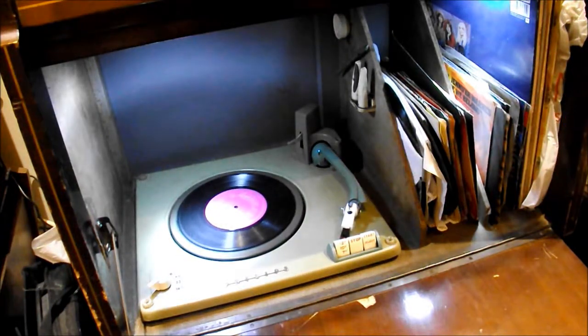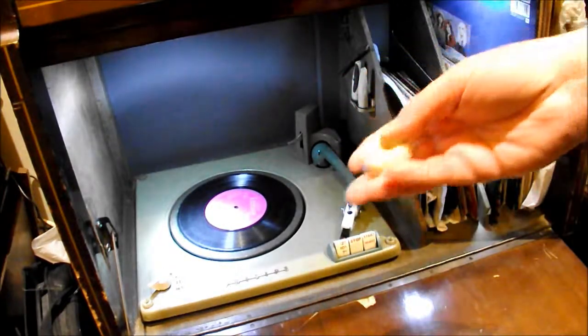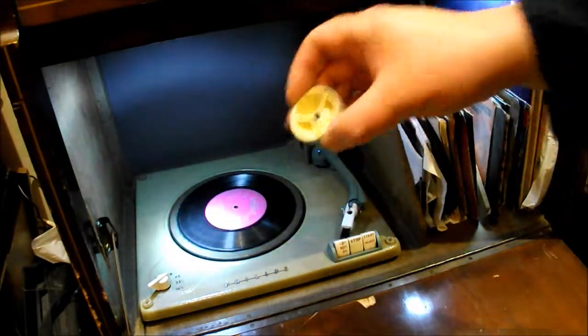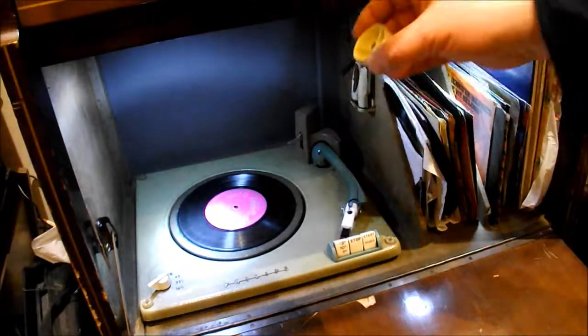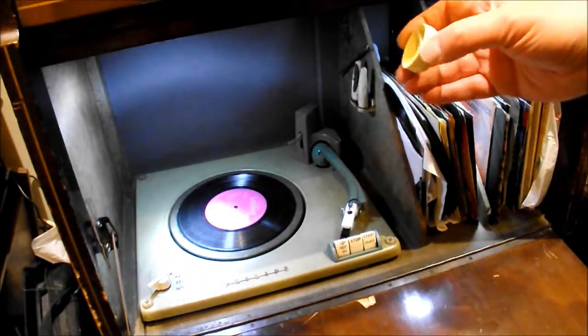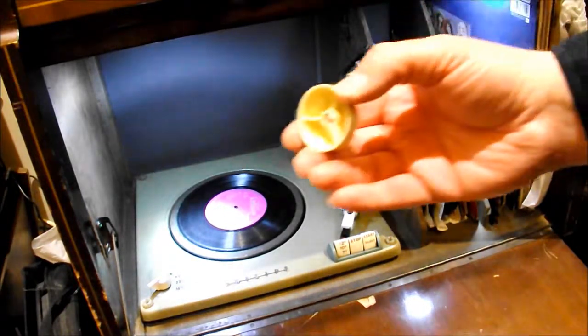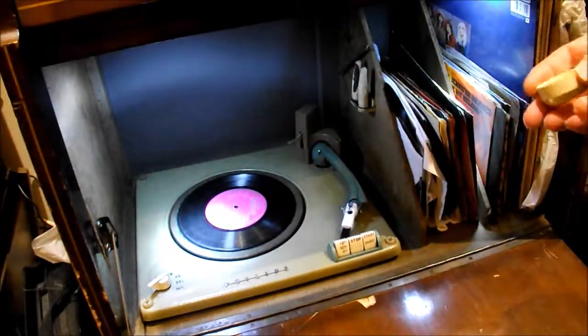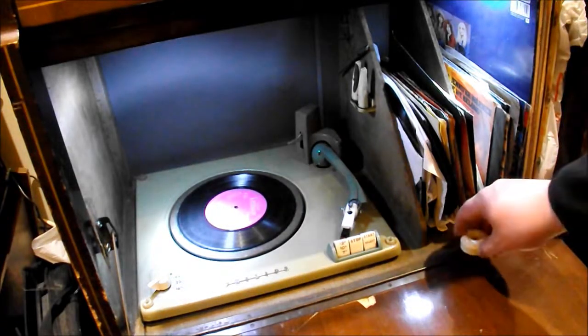I'd like to play more but YouTube will likely pick up on the copyright nature of anything I put on, so best not to. I still have some more work to do around the speed of the turntable — I'm not convinced it's quite fast enough, even though it's going at more than 45 RPM; some tracks sound a bit flat. There's also the center spindle — for some curious reason it's broken off inside and won't fit over the short shaft very well, although there is a longer shaft that came with it for use with the auto changer, which is incomplete so I can't use it. I'll 3D print a little insert for that, which should fix it.